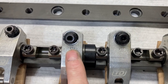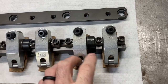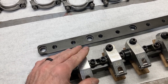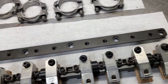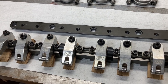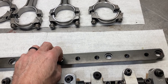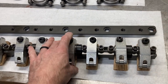You can get them in any rocker arm ratio you want — these are 1.8 on the intake and 1.75 on the exhaust. Very high quality. This is what I consider the ultimate in higher end rocker arm setups for most aftermarket and factory heads. Someone asked on another video why I'm not running a solid roller on my tunnel port dyno mule — it's because I'm planning on a pretty healthy camshaft that would require a lot of spring load, and for valve train stability with that setup I would have to go to something like this.